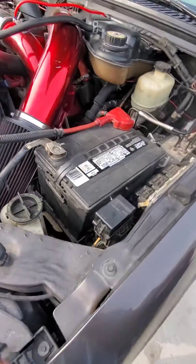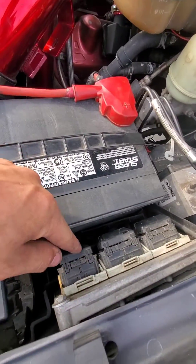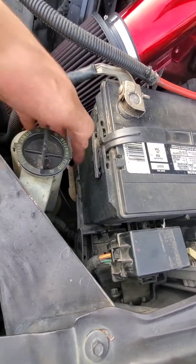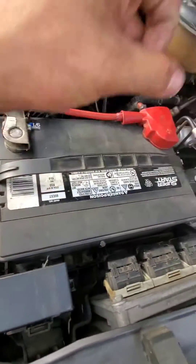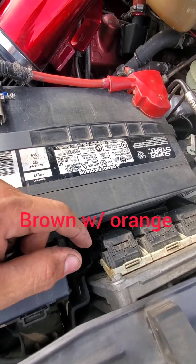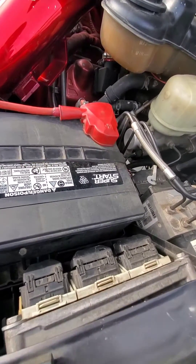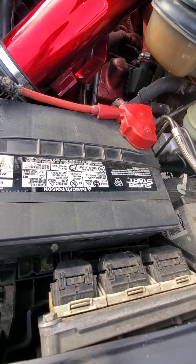So basically in the front end of your truck, right here is a plug for the PCM. You're going to have to take your battery out, take your battery mount bracket thing out right in there. And then your wire, you can pull it out so you can get to it. There is a brown wire with an orange tracer in there that you basically just need to clip your wire into, or you can splice it and run it back to your switch. Either way, it's just less wiring if you just splice into it.